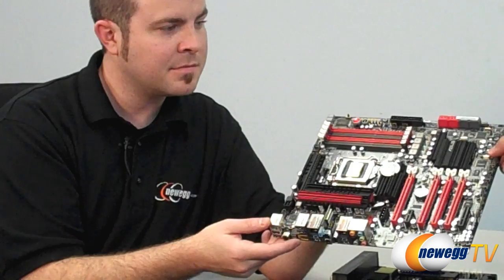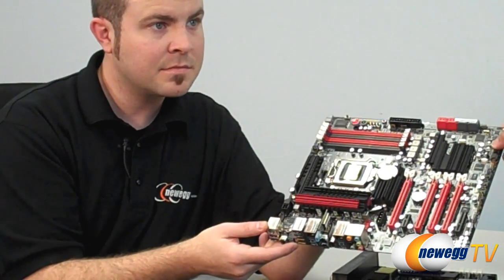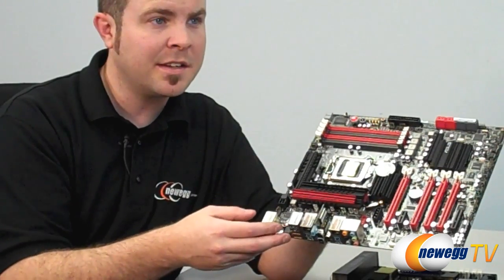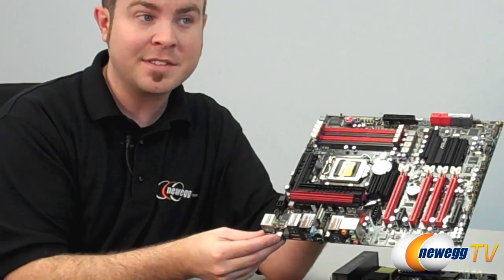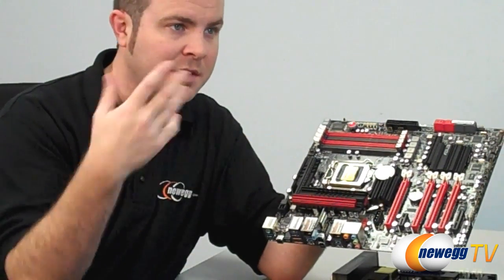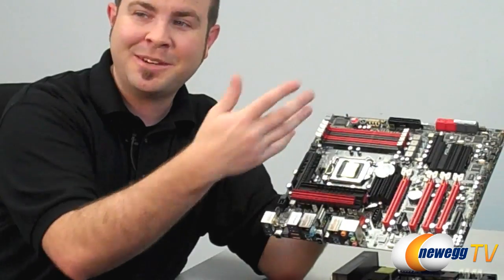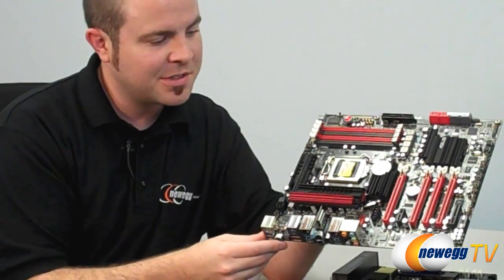You can do that to either BIOS because there are two BIOS chips on this board. Each BIOS is entirely bootable independently, unlike some other dual BIOS designs. So you can store overclock settings on one and gaming or 24/7 settings on the other. This is particularly handy as new processors come out — if a newer processor isn't supported by the original BIOS, you can just flash it off USB without needing to visit a store to borrow a compatible CPU.